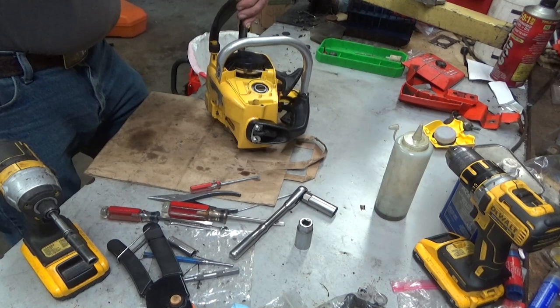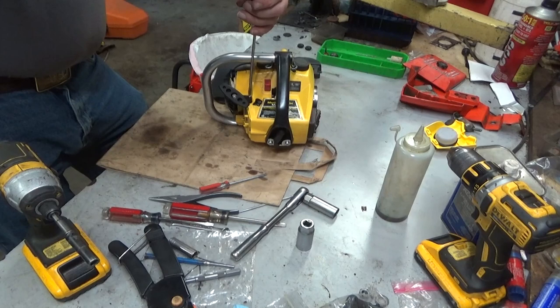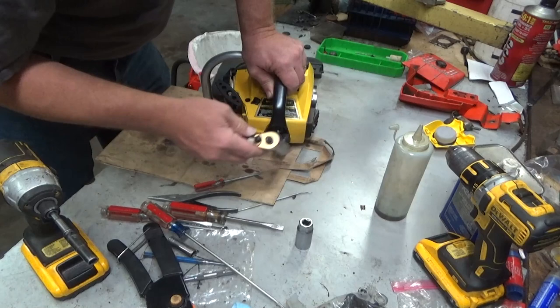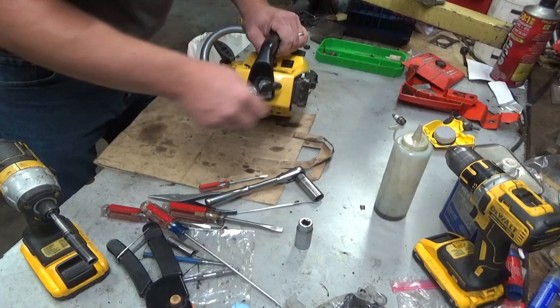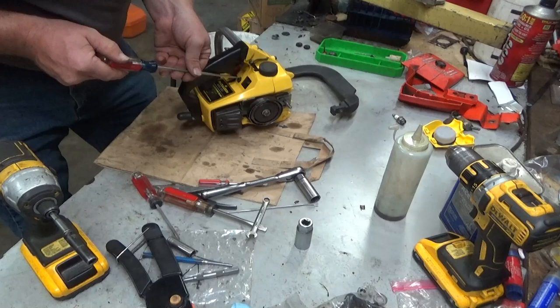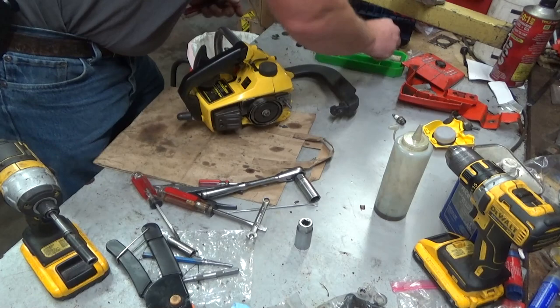So a couple thoughts come to mind. We could have a metering lever or fuel inlet lever that's set a little too low. We could have a deposit of felt from that new filter. Occasionally those aftermarket felts do that. They'll shed, and then, incomprehensibly, they will plug up the screen in the carburetor and fuel won't flow through them. Even though they're a filter, somehow they manage to pull themselves tight enough that it won't let fuel through. So that's a possibility. I suppose there could be a torn carburetor gasket on the intake manifold there. Seen that before. Any number of things.